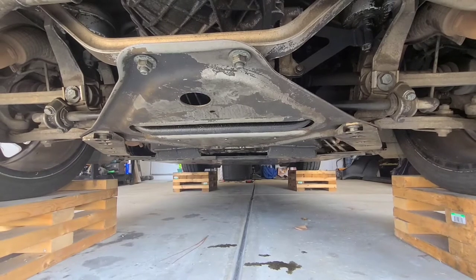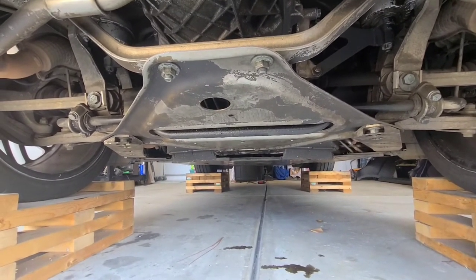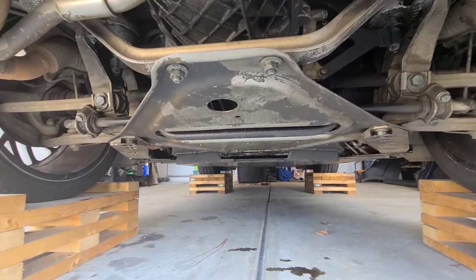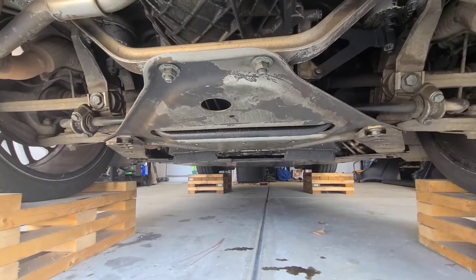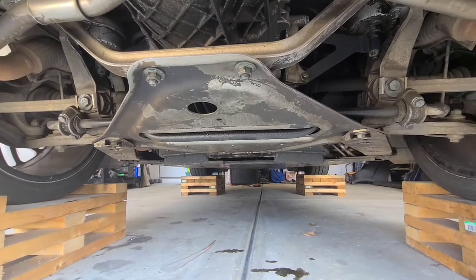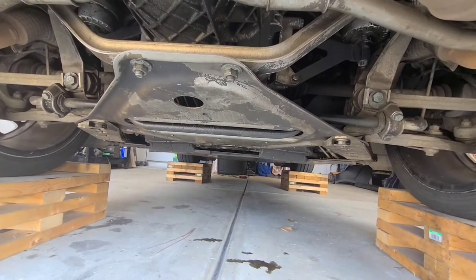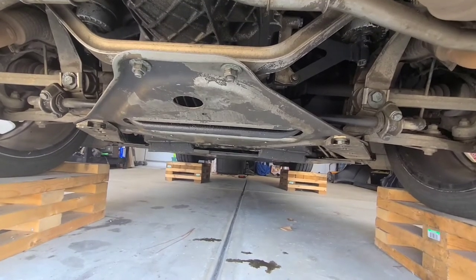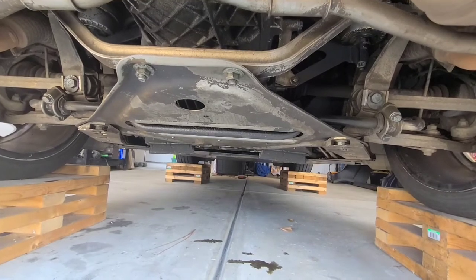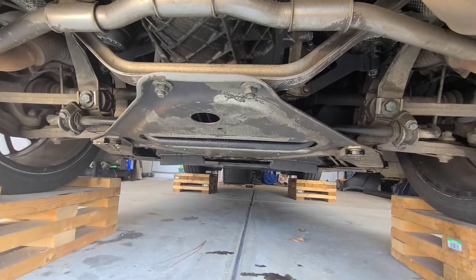I'm going to probably post this one because it's getting long. I've obviously got to take the flywheel off, which I didn't do last time since all I did was put on a new stage-one clutch. I think the flywheel bolts might be one-time use - if somebody could comment on that, I'd appreciate it. I've got a '101 Porsche Boxster Projects' book and obviously it's on the internet, but let me know if those flywheel bolts are one-time use.